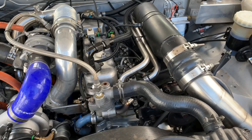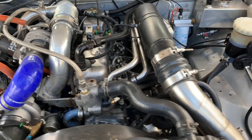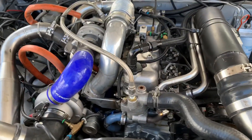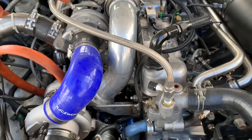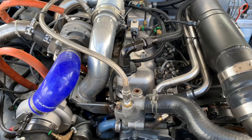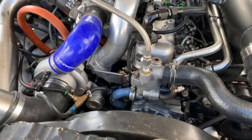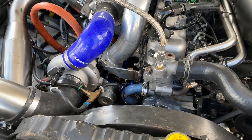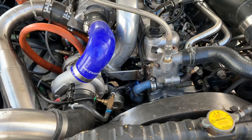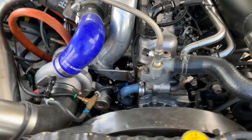That's about as far as we go with the stock bits and pieces. It's a compound turbo setup. The high-pressure turbo is a TD04L 14T compressor wheel, then we've got a GT2871 - not a genuine Garrett, a Garrett copy at the moment. Was originally running a Garrett but we'll go back to one of them eventually.